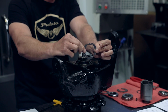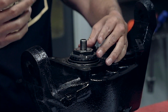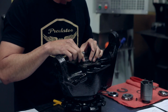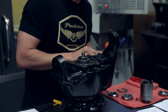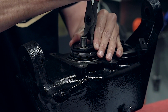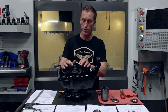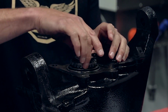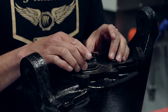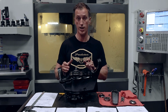So once that happens, this little tabbed triangle washer goes on top. Now, I just was lucky I found that's the correct location here, but it falls down inside there. And then finally, take this retaining clip. So now that's locked into place. I did not torque this down, of course. So on here, I replaced the washer with the washer that failed on a customer's truck that came in. So it's a locking spindle nut, which is not locking. It's advertised as being a locking spindle nut. It's really just kind of retained in place.